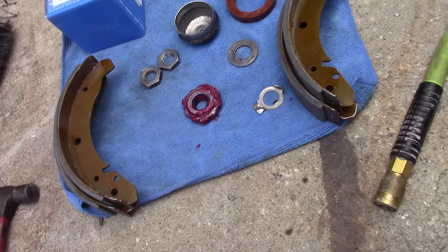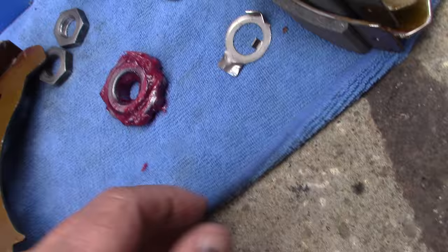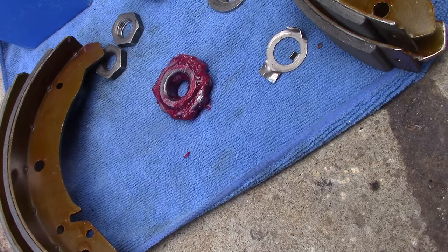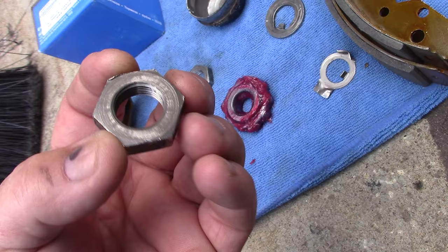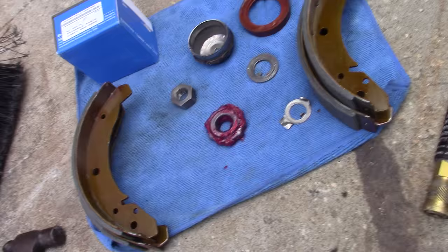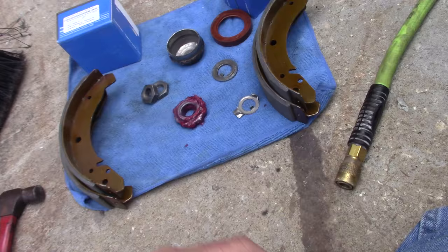This has the roller type bearing setup — it's got a removable race and large rollers in a cage. It's a little different than the typical tapered wheel bearing on the later model ones. The later model car has a single jam nut; these have two nuts — I believe they're 27 millimeter. When I went off to college I drove an early model beetle and had one of these bearings fail on me, and had a really hard time finding this hardware on the road.